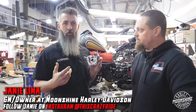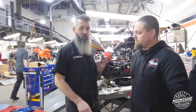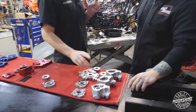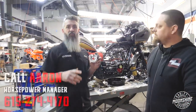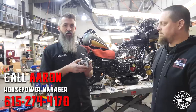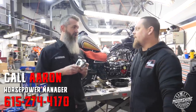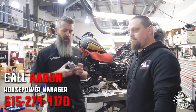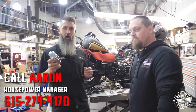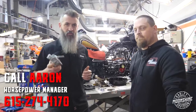If you're doing upgrades to your Harley-Davidson and you don't have a 2020 — you have a '17 or an '18 — we recommend going to the newest style pump. You don't have to go to an S&S or a Fueling. You can go to this one. The S&S and Fueling have some benefits we're going to go over in a minute, that's why we recommend them. But you can go to the newest version of the Harley pump and have the best oiling system that Harley's produced for these new M8 motors in your bike.